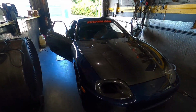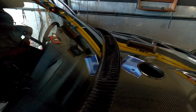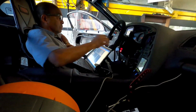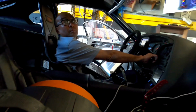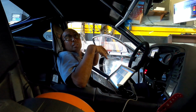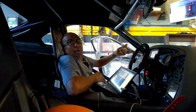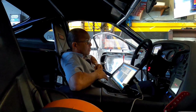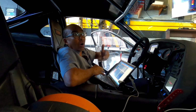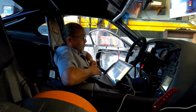All right, guys, we're now on the dyno. Still sounding kind of funny, no? Good? It's because it's in the secondaries, so it's not in the port, so it's not going to be clean. Okay. So once I swap them back around. Oh, you're running only the secondaries now? As the primaries. That way I know all 6 are working. I'm going to swap them back around. Okay.